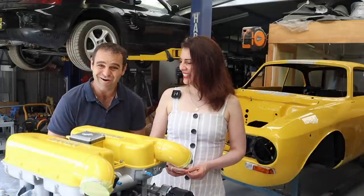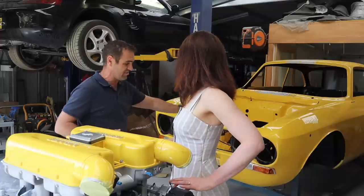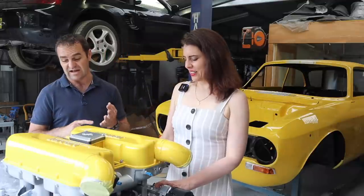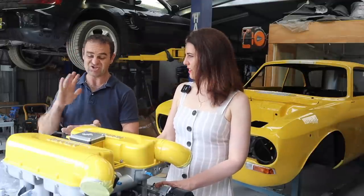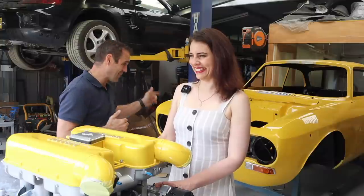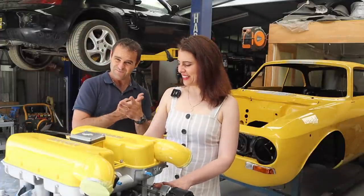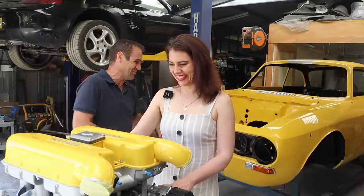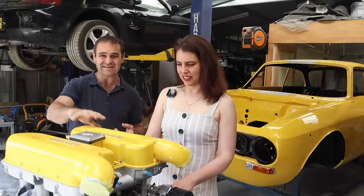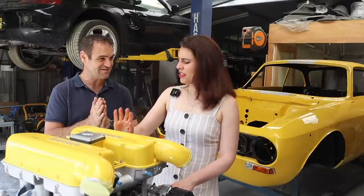On the Alpha, it might not look like a lot but there was a lot of stuff done this year. I did all the chassis bracing, seam welded it, built the new exhaust, smoothed out the bumpers, stone-guarded it, primed it, did all the body work, primered again, went through and tidied it up, primered again, painted it, cleared it, then went through and fixed a bunch of mistakes and did the stripes — then fixed mistakes and did the stripes again, then cleared it again. So lots and lots of iterations of the paint. It's now looking really good, and obviously sound deadening and servicing the Ferrari engine, painting things up, and now we're finally putting it back together.